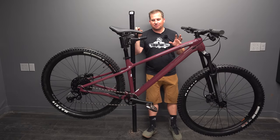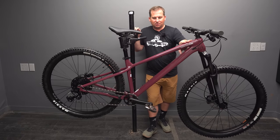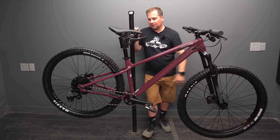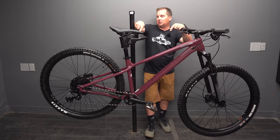All right, she's all built up. This is the Habit 2 in this beautiful dark cherry color. Final weight came in at 33.9 pounds. That's a hefty little bike. I'm running tubes in here.